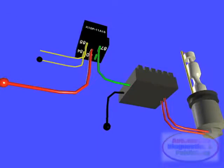The ballast itself needs to be connected to chassis ground. Do not accept any other type of ground. The ballast circuit needs to cope with the ups and downs of electrical current in HID systems. Finally, the high voltage output of the HID ballast connects to the bulb itself. These are the two wires you must watch out for due to the high voltage in them when operational.